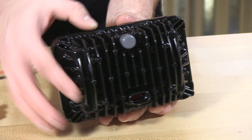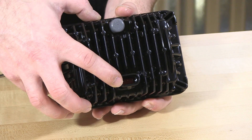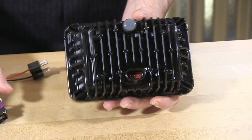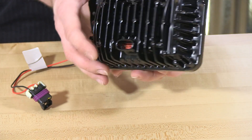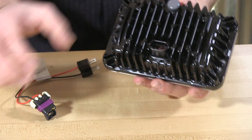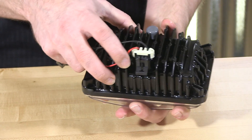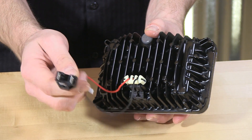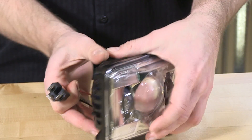On the back side of this, you have a Gore-Tex breather on the top, which is going to let air flow throughout this fixture. On the bottom, you have a water resistant quick disconnect — that's something that's changed along the way with this product. When it comes to getting this wired into your vehicle, for those of you using the standalone 4x6's, all you have to do is get the old fixture removed from the assembly, get the new one mounted into position, take your wiring harness, snap it into play right down here, and it locks into place with the tooth nice and solid. From there, it's a matter of plug and play with the connector — a 3-pin H4 connector, lead and ground to tie this into your electrical system.